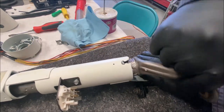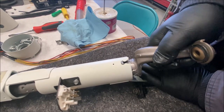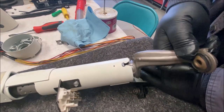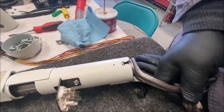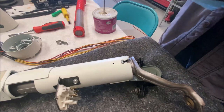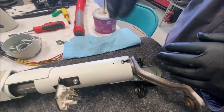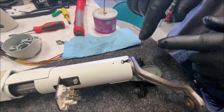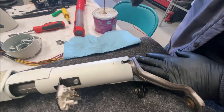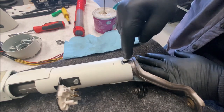That's it! Look at how nice — I'm pulling on this thing, it's moving at the top but it's not moving here, not one bit. See that — it turns nicely, nicely supported. That's probably 99% of the time, with the exception of the shift linkage, why your shift linkage has play. I have a video on repairing the shift linkage — watch that video, and do the lower steering column bushing, and you're set.